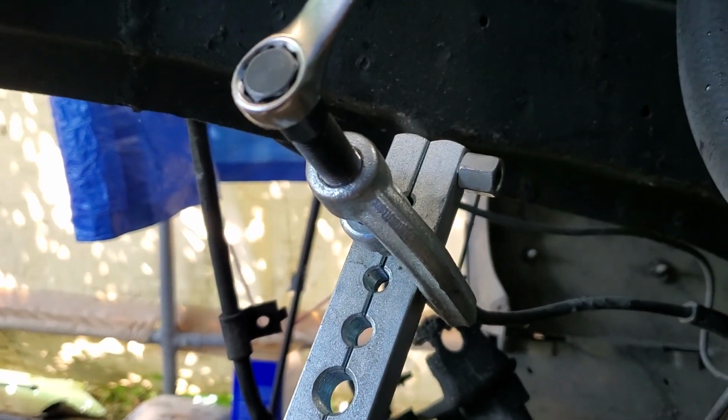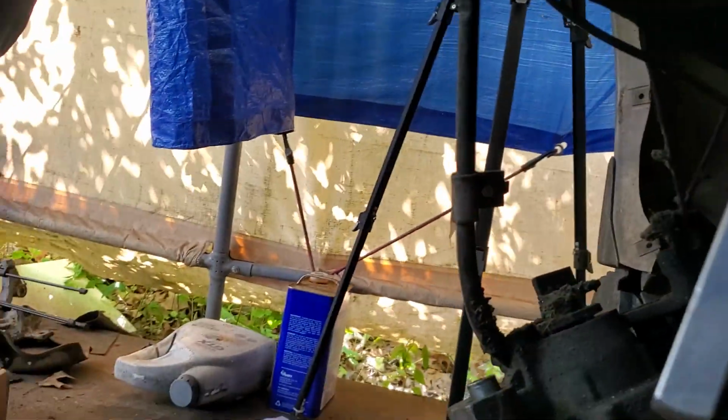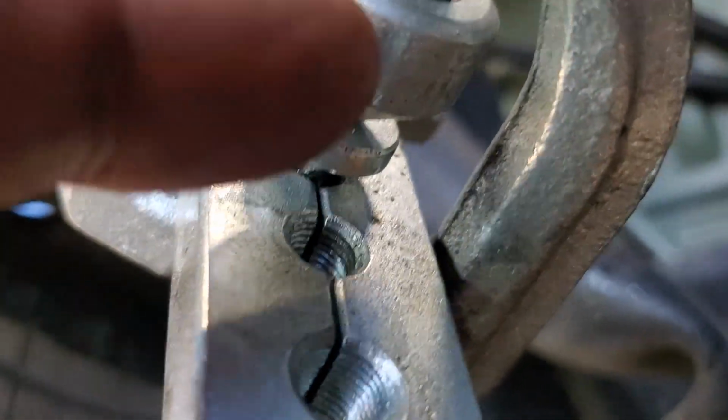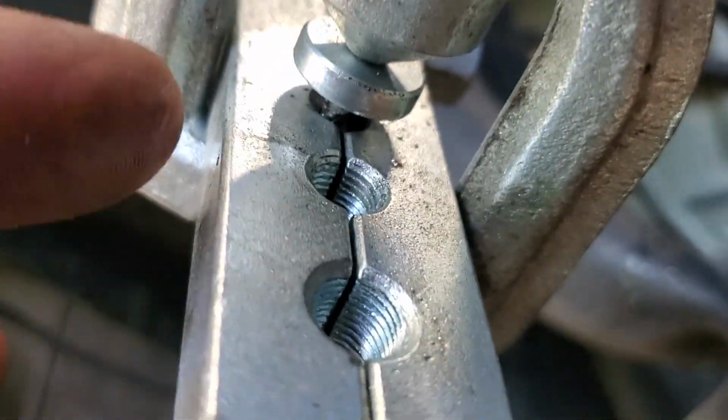Maybe I don't think I need the tool. I don't think I need that spacer. So I actually might have to pull that out because I think that makes me a bubble flare. Yeah, I think that makes me a bubble flare. So yeah, I actually got to not use that, but you can use it. You use that for the spacer. So instead of using that, we're gonna go ahead and just use the cone. Stick the cone down in there. It's just an inverted flare.